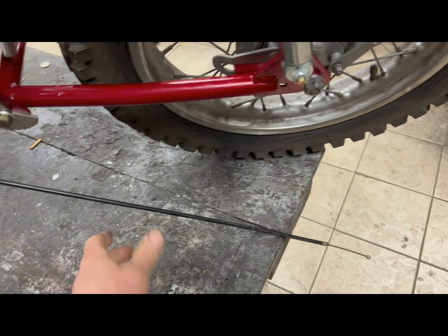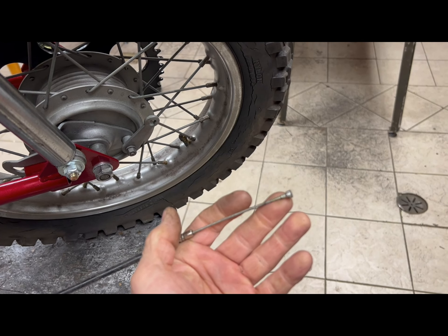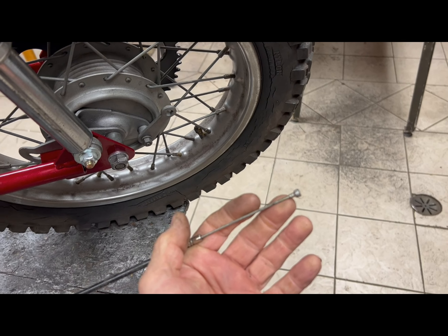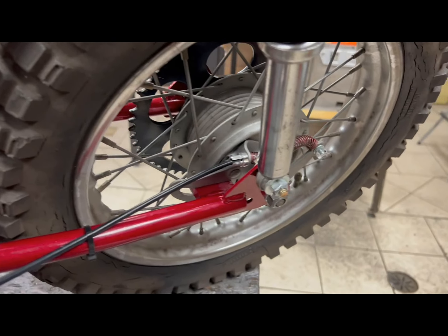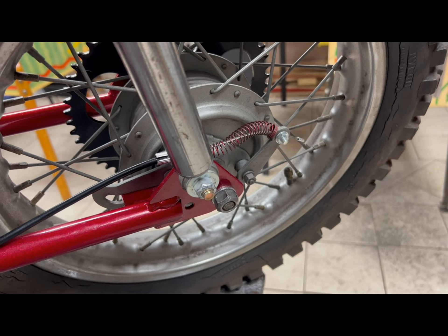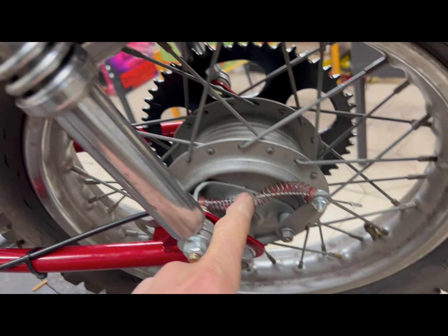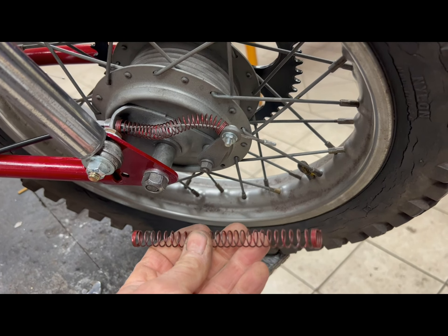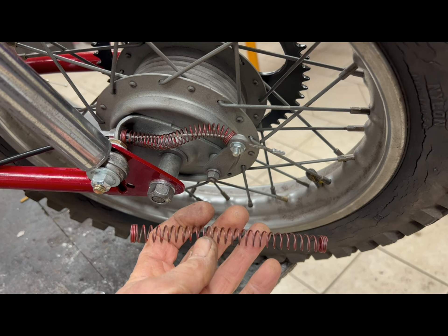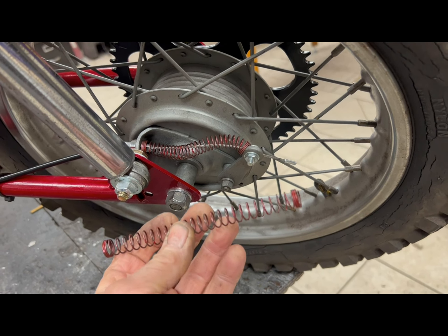This last tool is a cable cutting tool — it's actually a bicycle tool, but you can see how it cuts the cable from all sides. This is what you want, because a regular pair of dikes cuts from just two sides, squeezes the cable, and causes the end to fray. This is the best way to cut both the sheathing if needed and the cable itself.